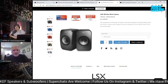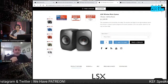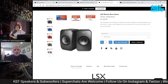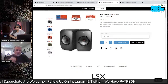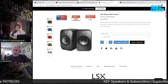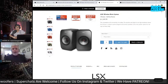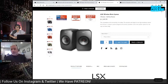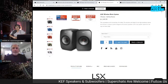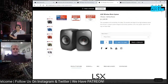Couple that with UniQ, which is really cool technology. A lot of people look at it and say it's just a coax speaker, but it's not. From a physics standpoint it is a coaxial speaker because it has a tweeter inside the mid-range driver, but more technically correct it's a coincident driver — everything is time aligned. The waveguides are all precise, the mid-range driver actually acts as a waveguide for the tweeter, and the beveled round shape of the LS family continues to act as a waveguide for both the mid-range and the tweeter.